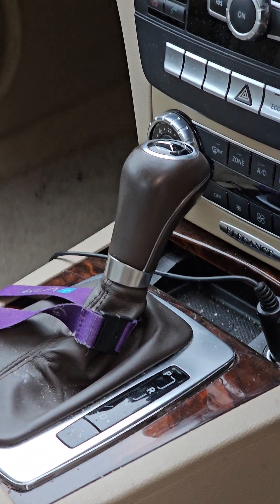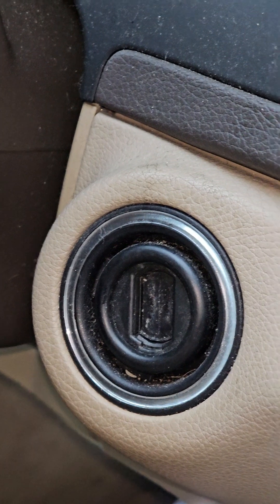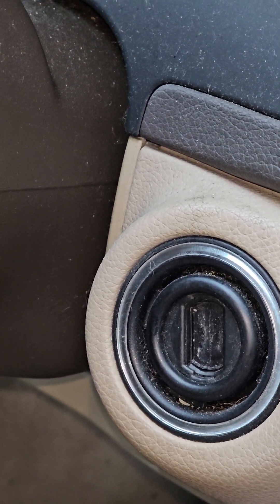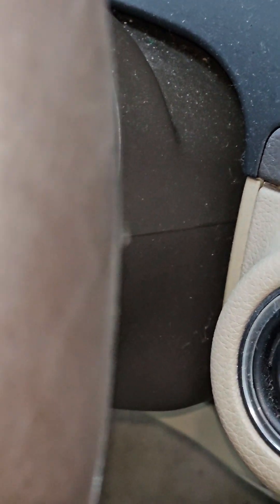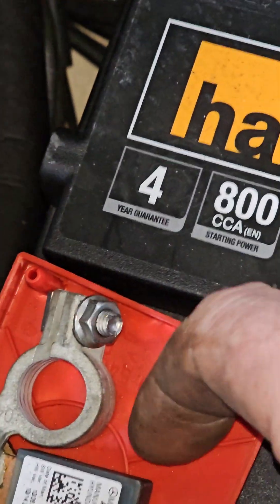As I go through the steps now, if the system is still working in essence, put the key in, turn it to the on position, listen for the noise, then check that the steering is loose — otherwise you can't do anything, it's got to be loose. Then come to the battery and disconnect it, which is very important because of the airbag system. I disconnected the earth terminal and popped the cover on it to stop it reconnecting.